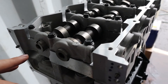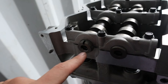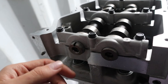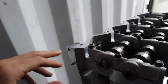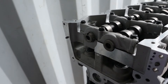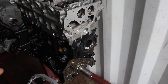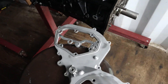I'm going to run through some tips for when you're putting it into the car. With the tone wheel — there's a tone wheel that goes on the back of the exhaust camshaft — you need to make sure you put that on and line it up properly. It's got a DL on it, so you need to line that up. I've seen it happen a number of times where people don't, and then you're going to have a whole bunch of cam-crank angle correlation issues. Also make sure you put the backing plate of the head on, because most of the time people are doing this in the car and it's very close to the firewall — you're not going to be able to get that on afterwards.